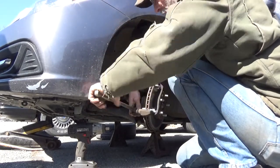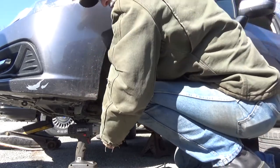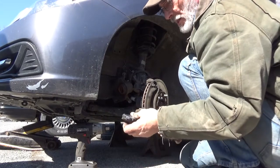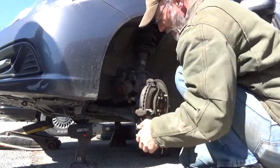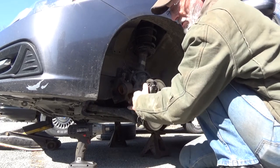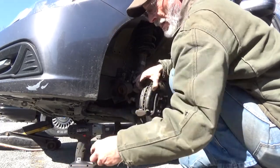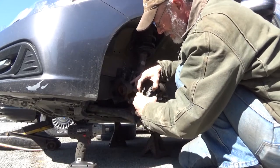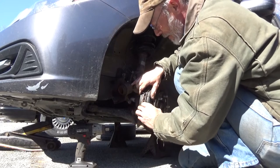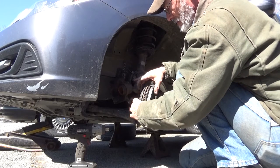Go ahead and torque to spec. Take your inboard brake pad and slide it into place, then your outboard brake pad — slide that into place. They should move in and out nice and easily, which they do. Then your little clips go in the little holes up top. Here's where it gets a little tricky: once you've got both clips in place, if you let go of the brake pads they're going to go flying on you — see, they go flying.